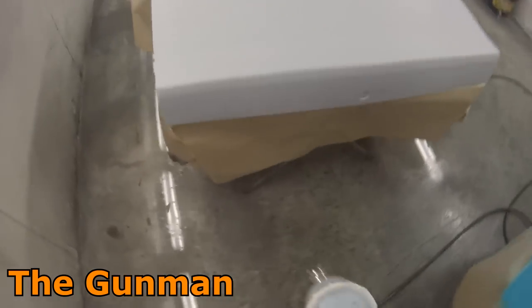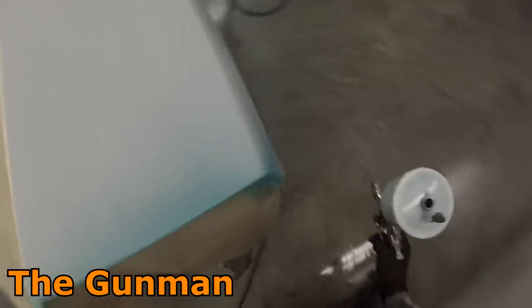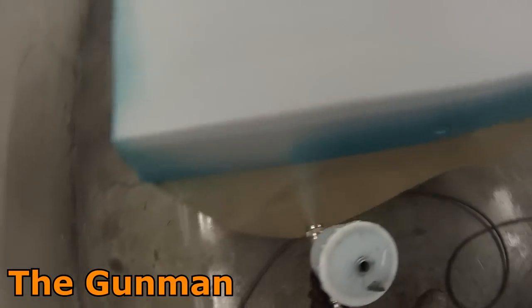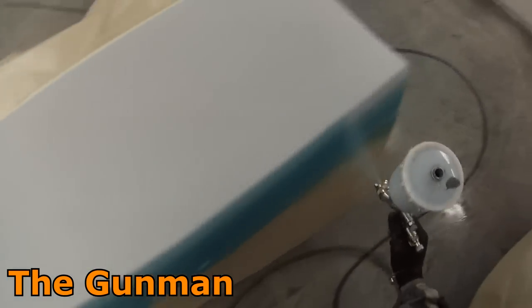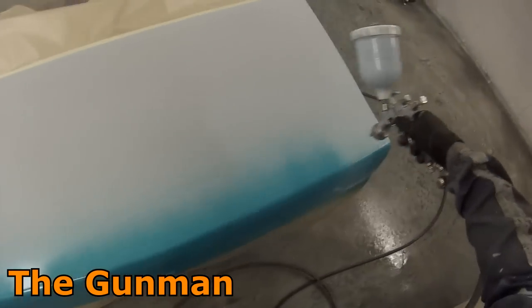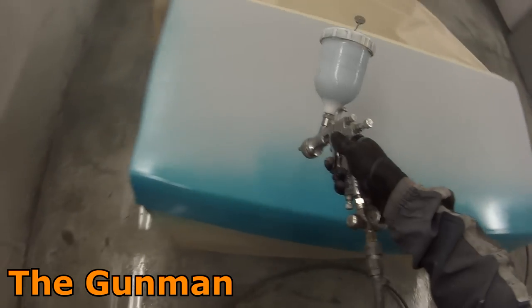I've done silver metallics and it's not that it's mottled, it's just that the metallics just aren't there. For a full respray it's fine, but if you want a really awesome light effect out of that metallic on a full respray, I probably wouldn't recommend going with Concept Paints. Some of their metallics are okay, but some are really average — I'm not the only one to think this; I've had a few other people say exactly the same thing.